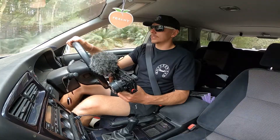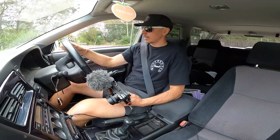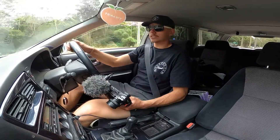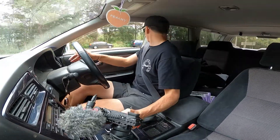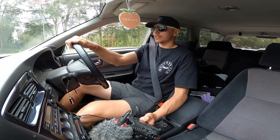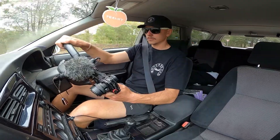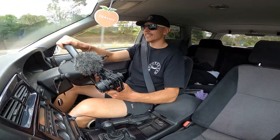There were a few arguments to be made of oh, it does nothing. Well, that's just completely wrong - it physically is doing something. We're obviously measuring more boost. There's another argument that says you can't even feel it - I would be on the side that says no, you definitely can feel it. It's just a little bit more alive, that's all. It's definitely not crazy - still a little bit lazy down low. I was reading another thing that said there's some sort of boost setting - under a certain RPM, I think it's like under 3,500 RPM there's one boost setting, and then as it goes over that it gives it full boost. I'm sure I can hear the turbos just going.